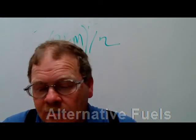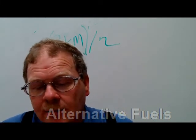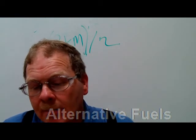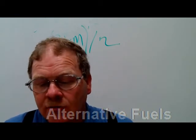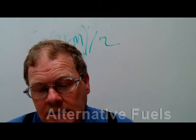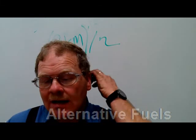A flex fuel vehicle has enhanced fuel system components that include all of these except what? A, corrosion resistant injectors. B, stainless steel fuel rail. C, corrosion resistant fuel pump. D, low temperature resistant O-rings. Say it's either A or C. That's D. That's actually D.